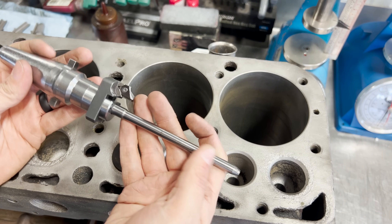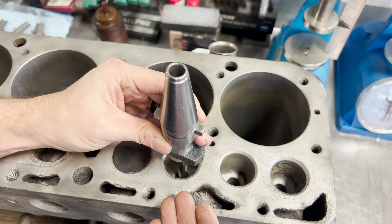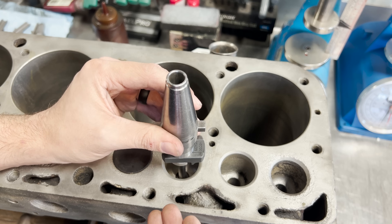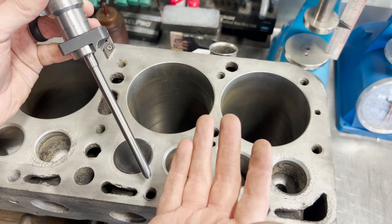I know what you're saying — it's a 1929 Model A, it ran fine before, it's only got like 4-to-1 compression, it'll be fine. And I agree it would probably be fine, but my goal as always is to do the best quality work that I can. When I have a machine that can cut really nice seats with the right pilot, that's what I prefer to do. So rather than trying to machine a nice, concentric, properly aligned seat with that much slop in the valve guide, we decided there might be a compromise.